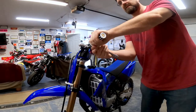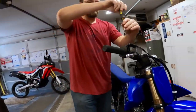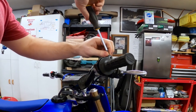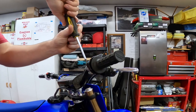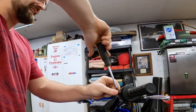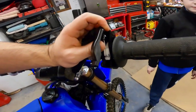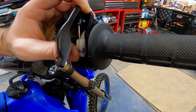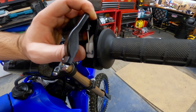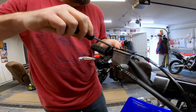On the throttle side I've got to get all these throttle screws out to open up the assembly. I'm not going to throw away this grip because it's hooked up to a stock throttle tube and it's nice to have a spare. Underneath here you can see there's a single cable hooked up to the throttle tube — we've got to get that out. In this new black piece there's going to be a black replacement for the factory one, two screws.